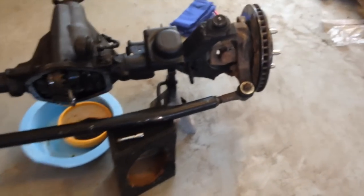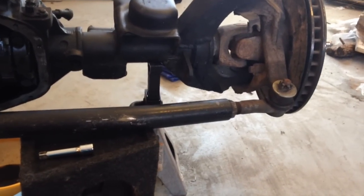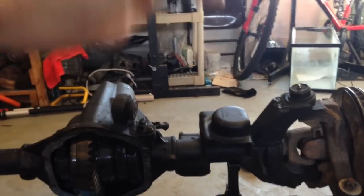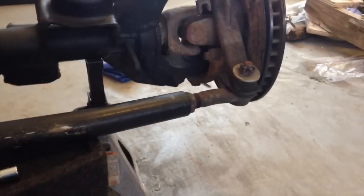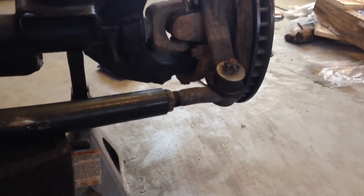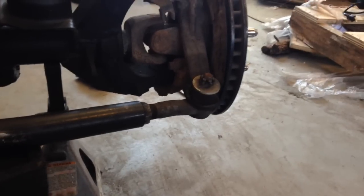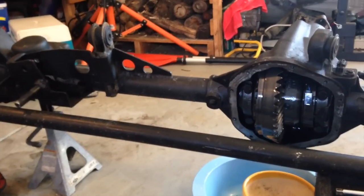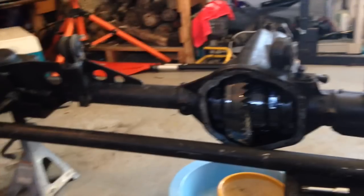Next to look at is the tie rod. This one has the Rock Crawler aluminum tie rod — one and five-eighths inch aluminum. The ends on the drag link are much bigger than the stock ones. It's beefier than stock but you can still buy the ends from a dealer, so if you ruin it you don't have to wait 10 days. Teraflex and Synergy make them too — comes down to preference.